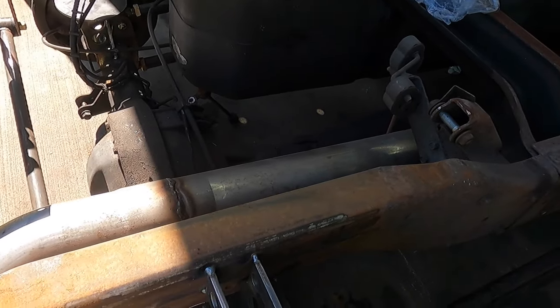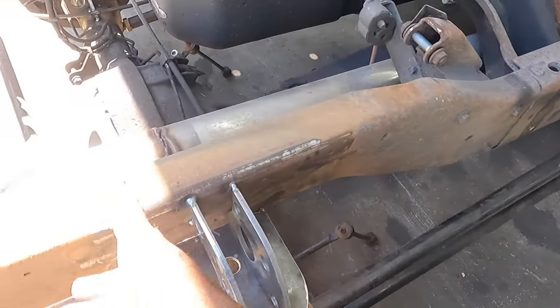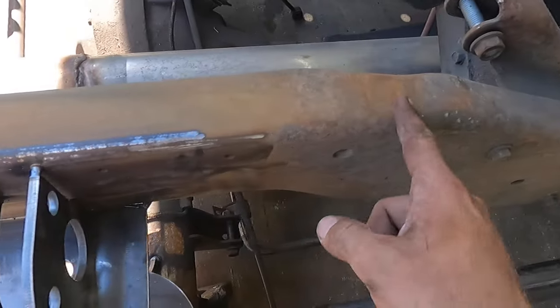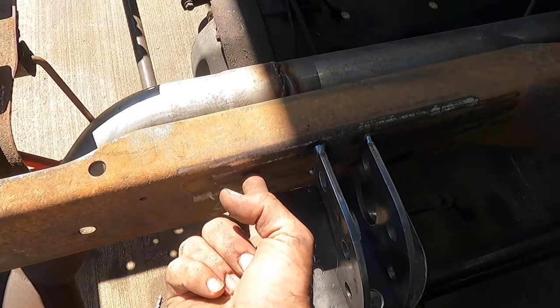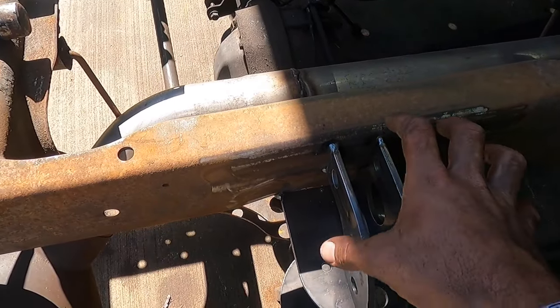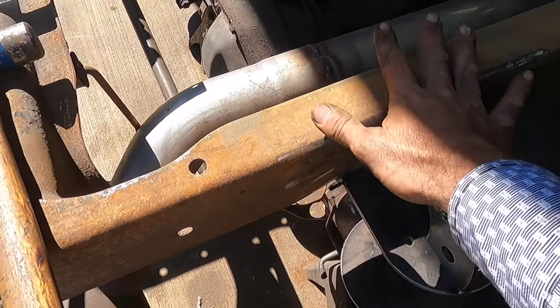Basically, I made one before for a second gen. I got two pieces of 3/16 square tube. And the cross member, if you can see, there's one that went here, and there's one that went here. So we just need to stay within those parameters. And we'll put a couple bolts on either side. And that'll obviously also help with strengthening our wrap here on the top.